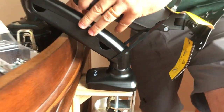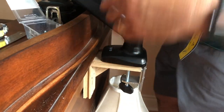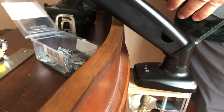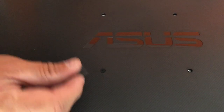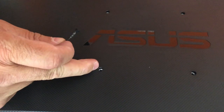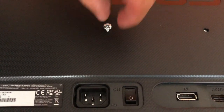Upon further measurement, I switched it — the other one was five and a half inches long, so it worked out better the other way. It just clears the top — see that? It actually worked out pretty nicely. A trick on the back of this ASUS: they have four screws but they don't tell you how to get the little plugs out. Get a nail or a little pin, and once you get them out you'll see that the threaded hole is right there. Then from the stand, check your screws to make sure they tie in. This one's 100%, so we're good to go.